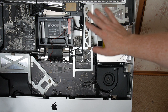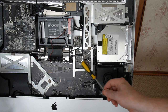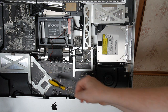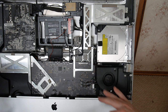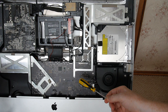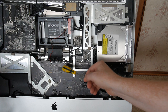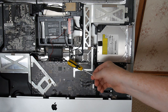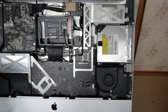Okay, so here we are with the video card again here. If you watch my first video, which is over an hour long, you know that I removed all of the motherboard, which includes the video card and the CPU attached to it. Some people said you don't have to do that. Look, I know that, but you actually do have to remove that entire logic board if you want to replace the button cell 2032 battery that's on the opposite side. There's no way you can get to the battery unless you take off the motherboard. So my 1 hour video is still very important.